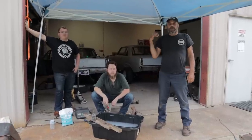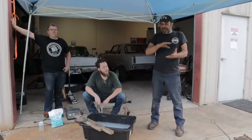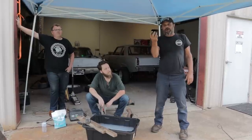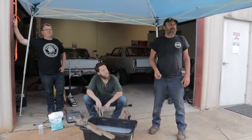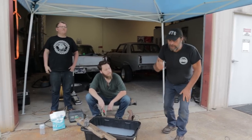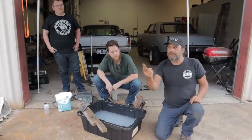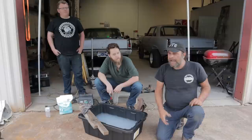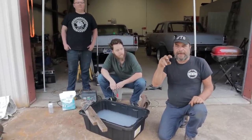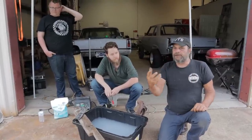A couple of months ago I bought that '61 Sportster, and one of the issues with that bike is that the inside of the gas tank was just loaded with rust — crusty, thick, flaky rust. So I said, alright, this is the time to try out some rust removers. I bought some Vapor Rust and did a comparison between Vapor Rust and vinegar, but neither of them really did the job on that tank because the rust is so crusty it needs more than just that.